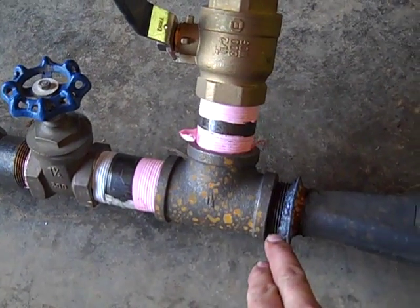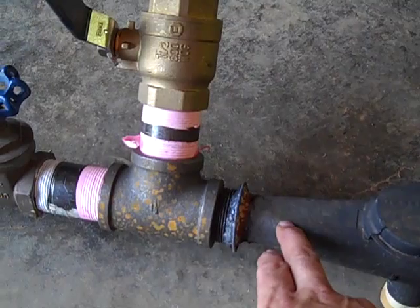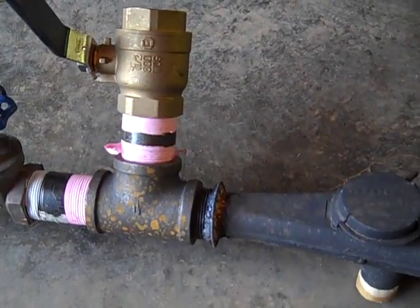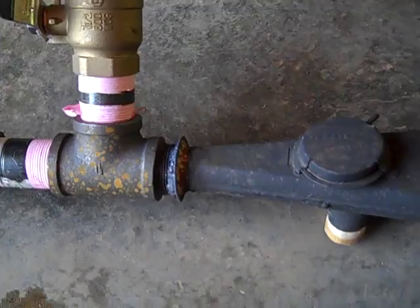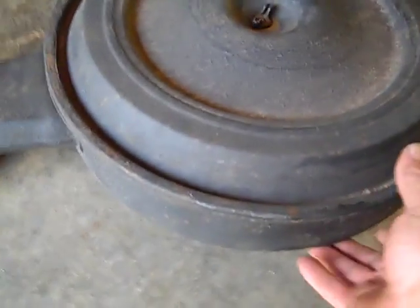Everything's coming down through here — got a welded-on threaded nipple to an existing air cleaner. It's a little crude but it definitely works. When I shut down the air valve and the shutoff valve while the engine's running on gas, it instantly stalls, so it's sucking pretty good air down through here. I don't know if it's going to be enough, but we're going to give it a try. Then I'm just going to screw this onto the existing air cleaner.